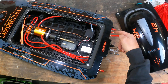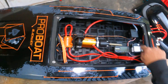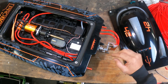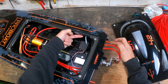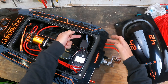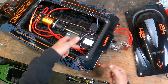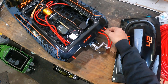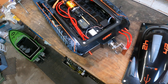The only thing you have to watch is when you're drilling the extra holes. Because of the webbing that's in the back here, you don't want to run into any of it. What I did is drilled this one here from the inside with a long drill bit, right in the middle of the webbing, then measured the distance and made it exactly the same over here so it's even and didn't run into the webbing. It's pretty easy, you just have to watch what you're doing.